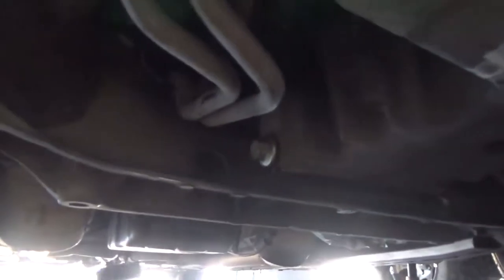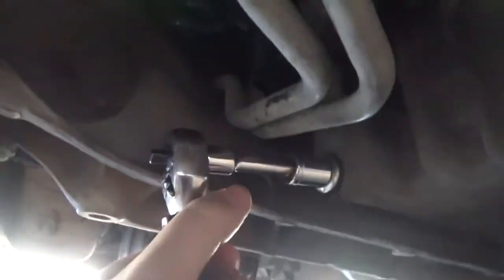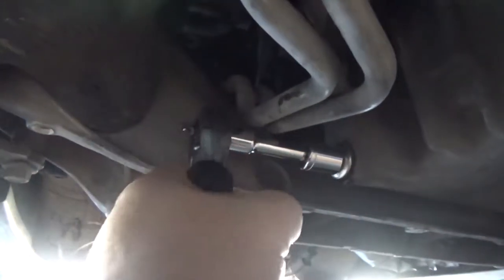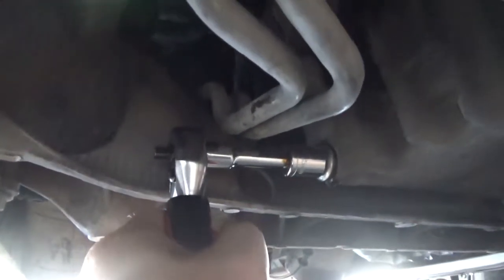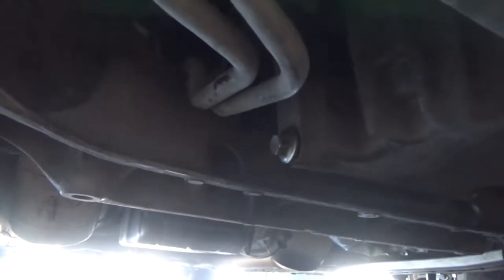Don't worry, that will lubricate your wrench. While the oil won't hurt your socket wrench, it will sure make a mess. So move your oil pan out of the way, unlike me, and now I have a heavily lubed socket wrench. Tighten it down. That should be good. And wipe up any excess oil. Of course, you'll want to come back and check this when you start filling up with oil to make sure none comes out. Now we can remove our oil filter.